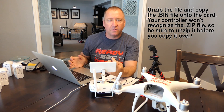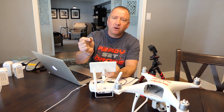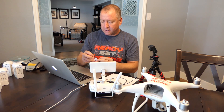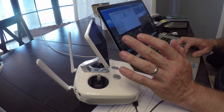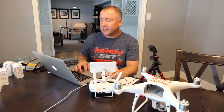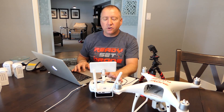This video may be a few months old by the time you watch it and the next update may be a different size, but it's a fairly big file — this one was over one and a half gigs. When I actually pulled the micro SD card out of the controller after formatting it, I ended up with a folder called LOST.DIR — all capital letters — on my micro SD card. The card is labeled NO NAME in all caps. I dragged that bin file onto it and then put it into my controller and turned on the controller.